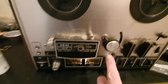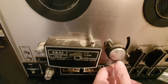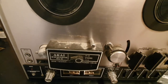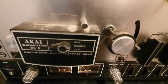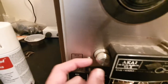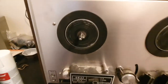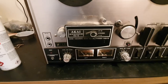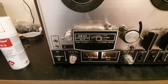The pinch rollers — this one is extremely dirty. Window cleaner is a good thing to clean them with; it's not as harsh as isopropyl alcohol and it cleans very well. You've got a bearing here — you've got to take this cap off and clean it. That's just basic maintenance I'm talking about here.